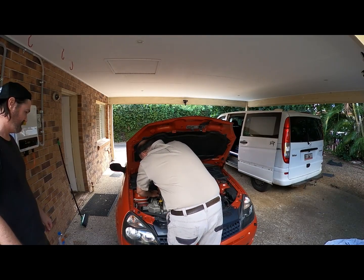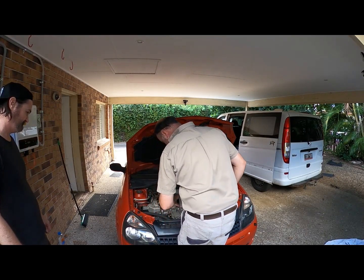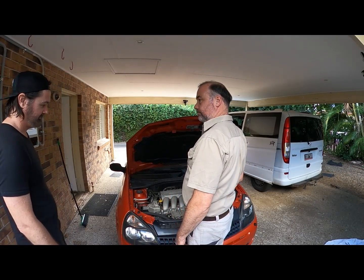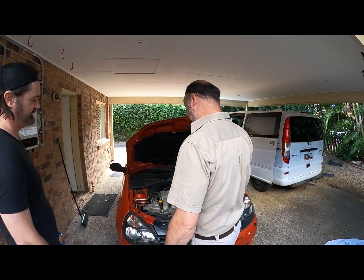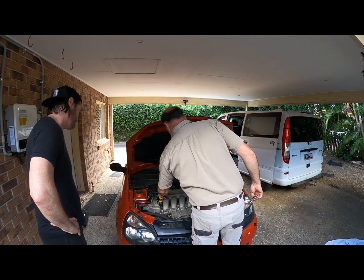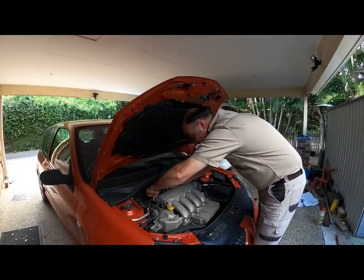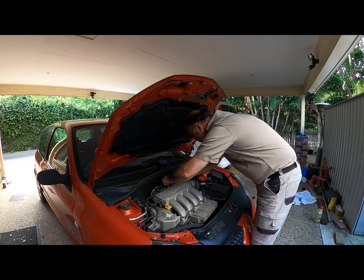Do we want any upper cylinder head cleaner? Not really, because it's a port injected motor, so it's cleaning. They're washing the back of the valves. Okay. All we're going to have is a bit of muck inside there. All right, we've got that disconnected. Disconnect this one, because it's all pristine. EGR purge, I think, is what that one is.